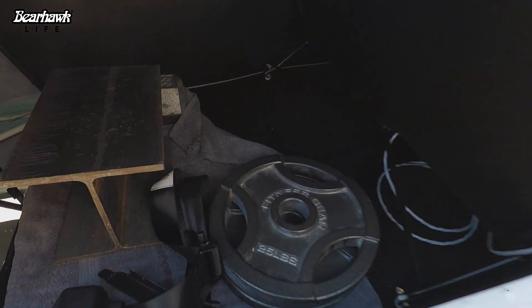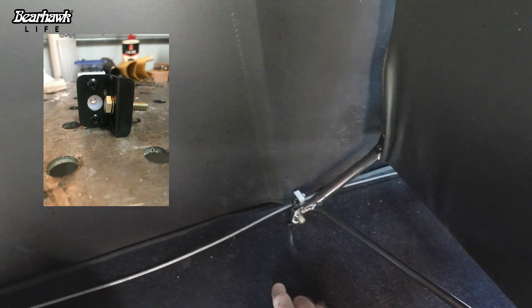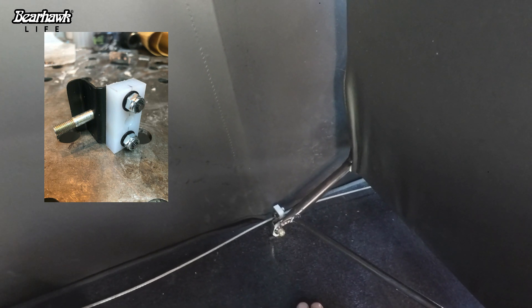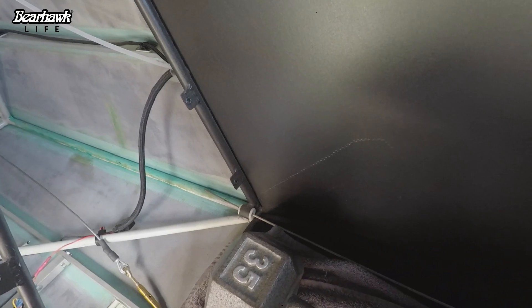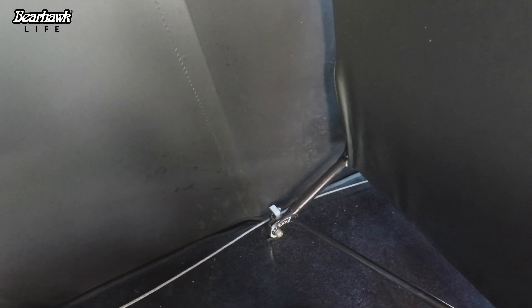One of the issues I had was the left rudder cable was rubbing up against this seat bracket. So this is what I came up with to protect that cable. I took a piece of 4130 chrome moly, sixteenth inch, cut a hole in it, bent it, put a little tab on here to keep it from twisting. This is just a piece of nylon from some woodworking stuff I have for a table saw sled, and I just screwed that in there. These are the fair leads that are already installed in the frame when you get the kit - it's just that most Bear Hawk kits have already accounted for this. What they've done is they've just welded a round eye for a fair lead onto the back of the seat bracket. It just so happened my kit did not have that.